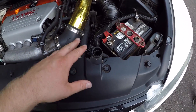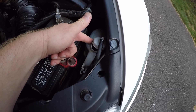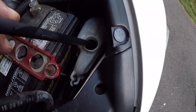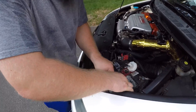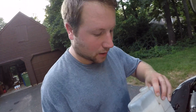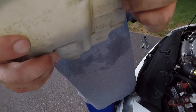Patiently waiting for everything to drain out of the radiator. I'm going to disconnect the reservoir right here on the side — literally all it is is a line — and drain out all the leftover coolant that's in there so we can refill it up to the max line with fresh coolant. All you have to do is pull upwards towards yourself; there's a little channel here and it slides right into a bracket.